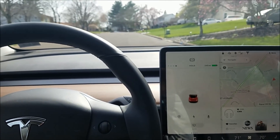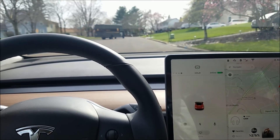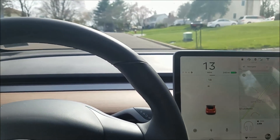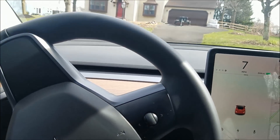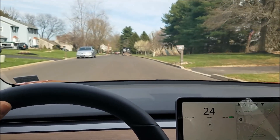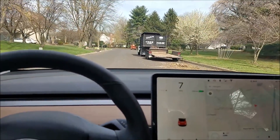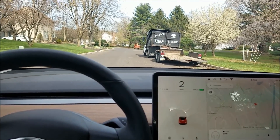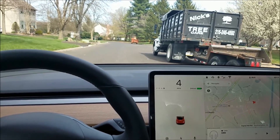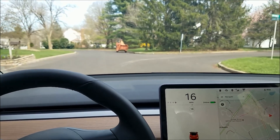Hold the brake — basically if you have your foot on the brake when you come to zero, you will immediately go into hold and you won't roll backwards or forward. It probably works the same going down a hill, so let's try that. I'm gonna go down a little incline here. If I put my foot on the brake but don't come to zero and let go, I will just continue to roll. I don't have creep on, so I'll continue to roll.